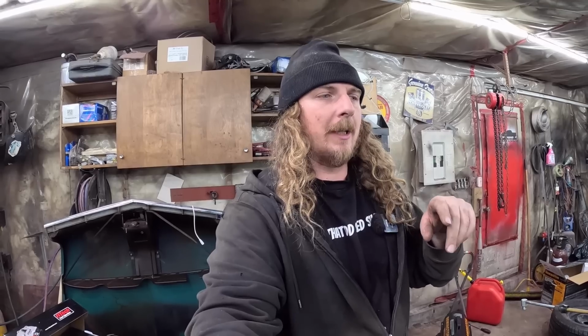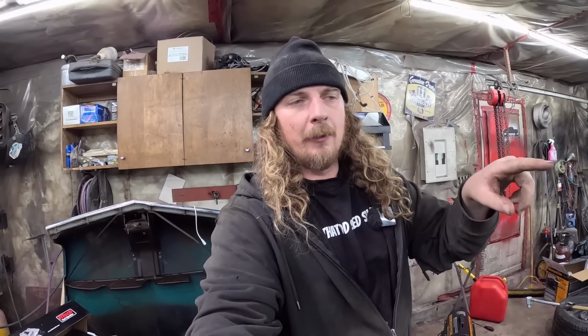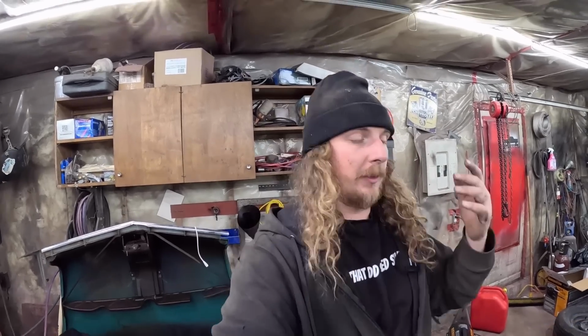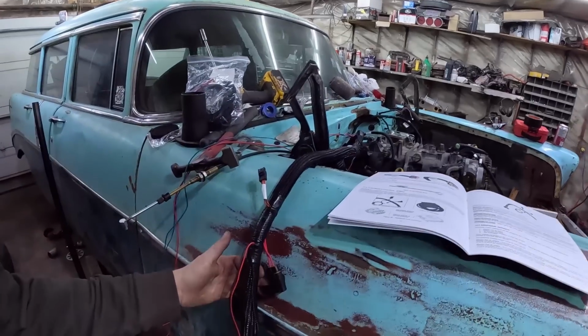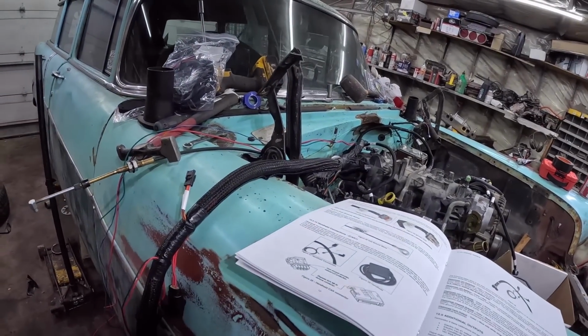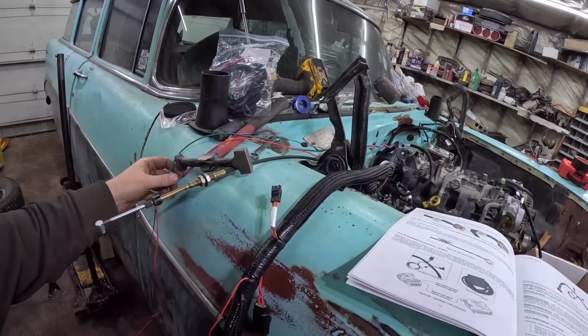We got everything clipped together for the most part on the motor. We don't have the injectors dialed together. I did some reading. Those grounds are important to the cylinder heads. That grounds the coils. So you have to have that taken care of, just if anyone's wondering why. Now these, I kind of undid a little bit. I thought some of those other things were needed for the tach, but that's actually all here.